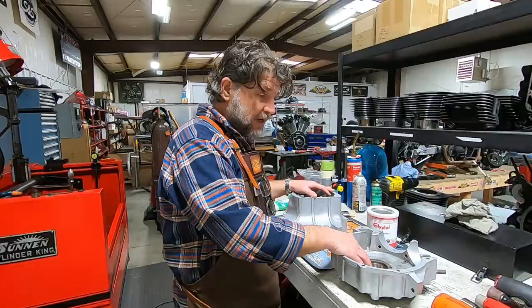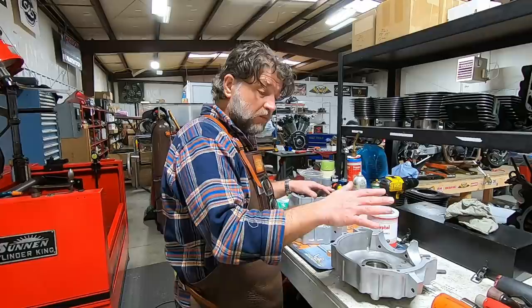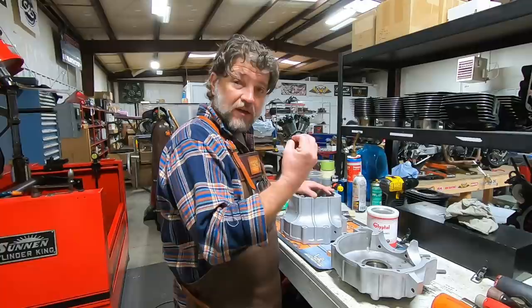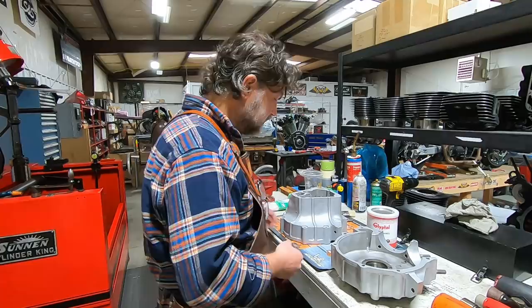I was just having a conversation with Barry Wardlaw from Accurate Engineering the other day on this particular subject. And you can put them in a hot sink all you want with Dawn. You can use solvents. You can, you know, whatever you want to do to clean them. When you blast, that media will actually impregnate into the aluminum. And what will happen is those cases or cylinders or heads heat up, then that media will release from the pores and can absolutely destroy an engine. So being I don't know the history of this, we're going to take a lot of extra precautions to make sure that that's not going to come back to haunt us.